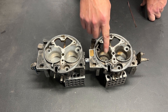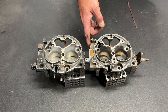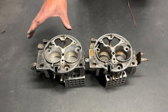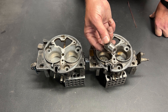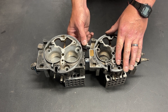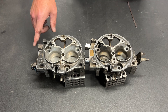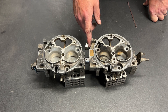Other than blocking the injector holes, the only thing left to do is deal with the IAC. The threads where we took out the IAC are metric — M20 by 1.5. I wanted something to run to an external IAC that I could put some hose to, so I found this little fitting off of eBay: M20 1.5 to 3/8 pipe thread. That is just going to go into both of these idle air control circuit bungs. Then it's a simple matter of running a hose from each one, connecting them together, and going to a GM type IAC. I'll use some thread sealant on that to make sure we don't have any vacuum leaks.